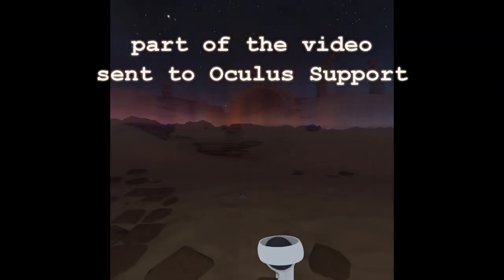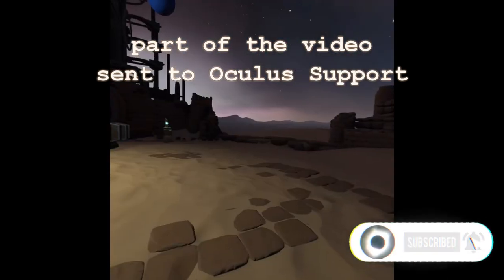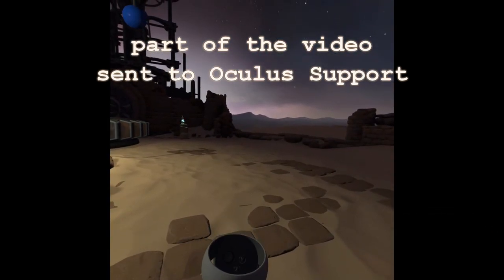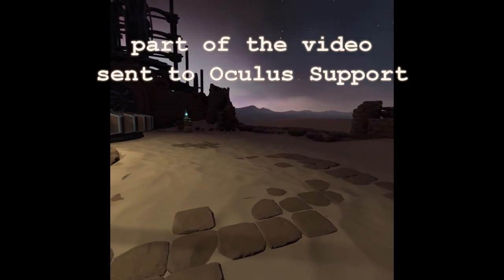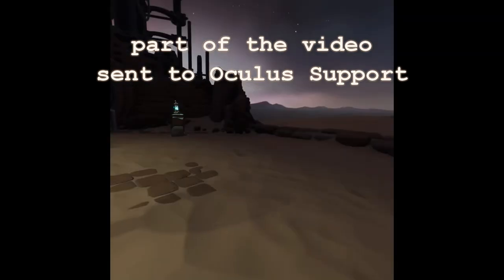If you have a problem with your Quest controller like I did with my right controller — I push the joystick forward, no problem. The left controller, I push the joystick forward, nothing. See, it comes and goes. Pushing it forward, there we go, now it's working. And now watch — if I start slightly turning it left, now it cuts out. The thumbstick was kind of glitchy. Something happened and, for example, I would play Pavlov and press forward on the thumbstick to go forward, and it would go and stop and go and stop — extremely glitchy. I thought maybe it was a firmware problem, but it turns out it was a hardware issue.